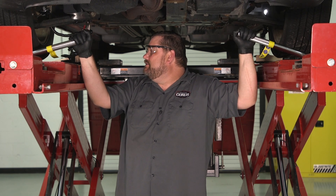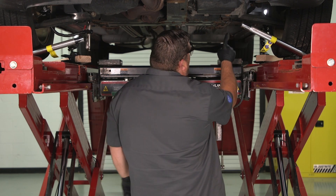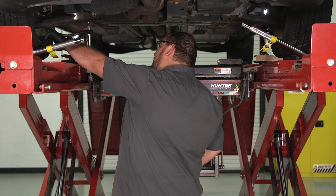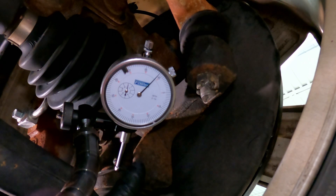I do hear a little bit of noise — it's really just the rack creaking around a little bit, and I'm not really seeing anything. For the sake of time, I don't want to show you every bushing in this vehicle, but this vertical control arm bushing is one I can show you really well, and these are known to fail on these vehicles. I'm looking at it as I work the tool and not seeing any movement there. To give you a good visual indication, I've placed a dial indicator clamped onto the lower control arm with the pointer touching the ball joint. As I work the tool, it's a very minute amount of play in this ball joint, and I have a sneaking suspicion that it may be the problem here.